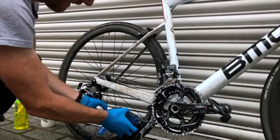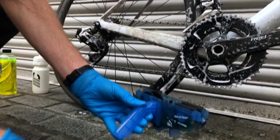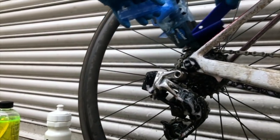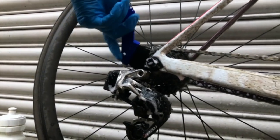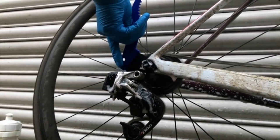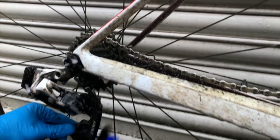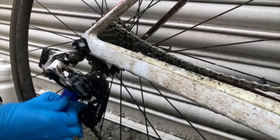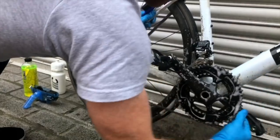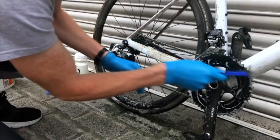Whilst you've got the chain drivetrain in this state, it's a really good idea to drop that off. The leftover degreaser you've got in there is still perfectly usable, so I'll actually pour some onto the brush and the cassette at this point and agitate that. You can even just hold the brush on while you rotate the pedals around. Simple techniques that really help for a fast drivetrain degreasing. The other thing is the jockey wheels — just get in there with the stiff brush and give those a good old scrub. Then use that on the jockey wheels while you're rotating, and a quick scrub around the chainring sprockets.